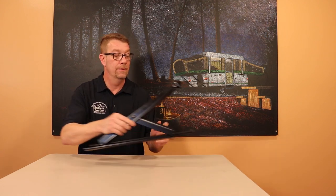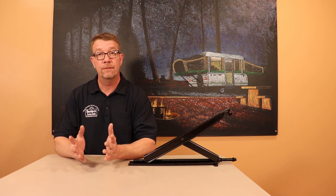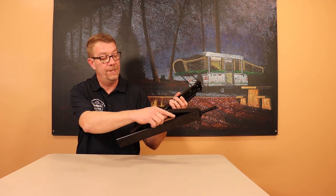Line up your new jack to the trailer frame, crossmember, or mounting plate, and use a large clamp to hold it into place. Your jack needs to be positioned so that the disc does not protrude past the camper body. Install your 17- or 20-inch jacks with the screws and lock nuts that come in the kit, or if you have studs, replace with new lock nuts. If you're doing a new install, first clamp the jack to the mounting frame or to the crossmember and frame body. Use a center punch to mark the mounting holes. Drill 13/64th mounting holes, then install the jacks with the self-threading screws and lock washers. These jacks can also be welded to the frame — first clamp the jack securely to the camper, screw the jack all the way down to the ground, then weld the jack body to the camper.